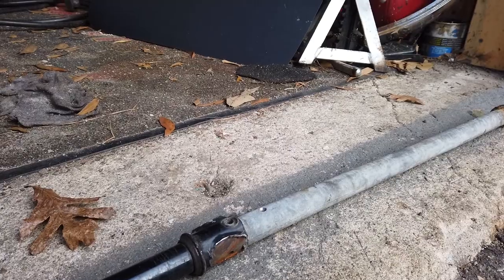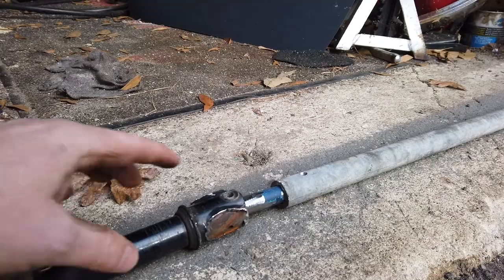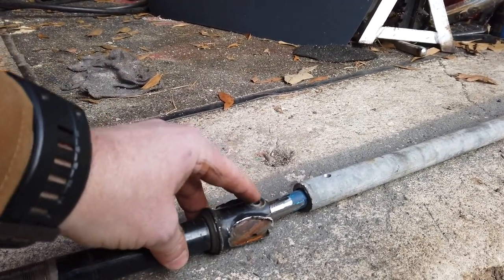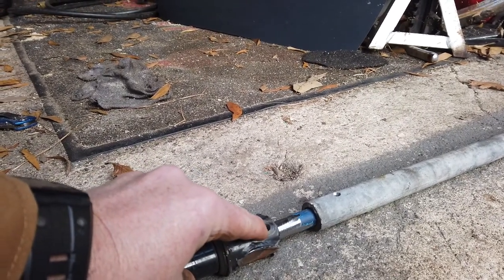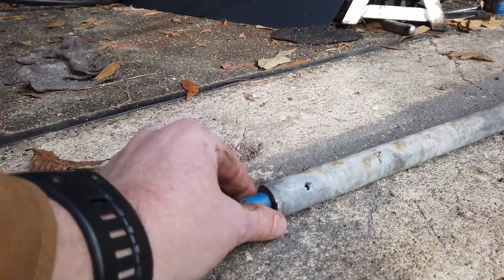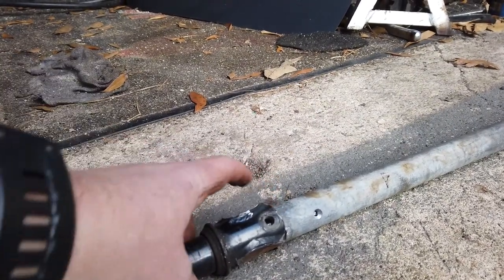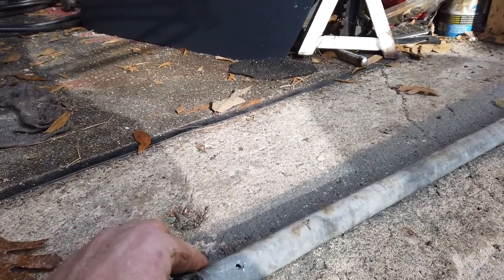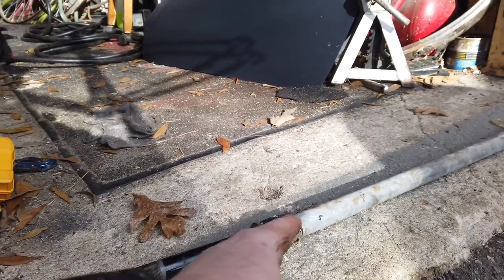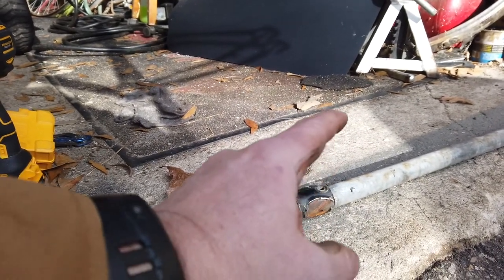I have slightly prepared this steer tube, and what I've done is I've found a skinnier piece of steel off of a bike frame that will fit in between here, and so I can put some welds in these brake holes like rosettes, and then I've drilled some more holes in here to do the same thing. That way there's a little bit more support when I put it together than a wrap weld around here. I'm going to try my best to keep it straight, but no promises. I'm going to clean this up because it's galvanized. I'm going to grind off the coating before I weld it.